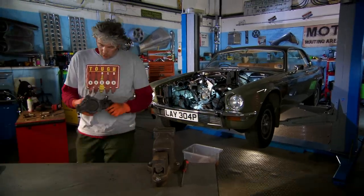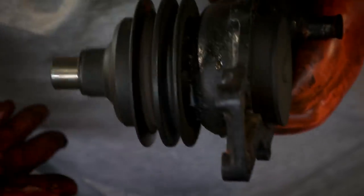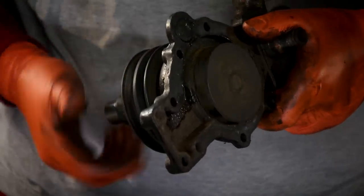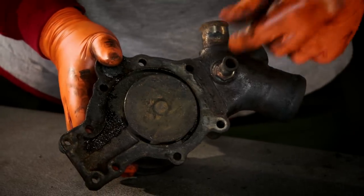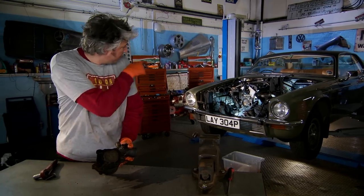Here is our water pump. You can see you've got pulleys on the front there. The V-belt goes around the crankshaft — that's what spins it all around. Then look on the inside, you can see the impeller spinning around there. That's actually sucking water through from here, from here, and from here, and then it flings it out through this little bit here that goes into the engine just over there.